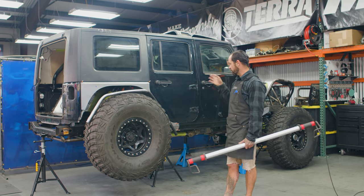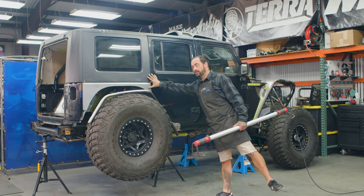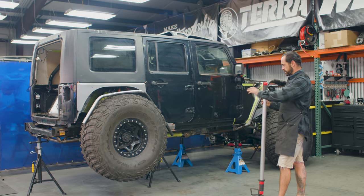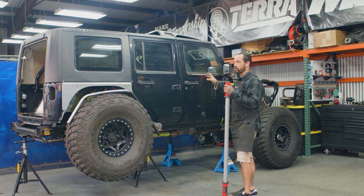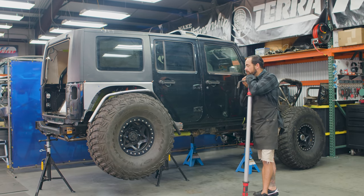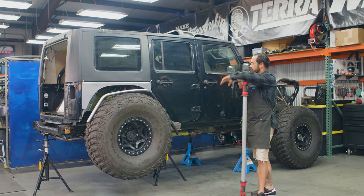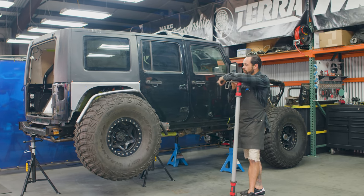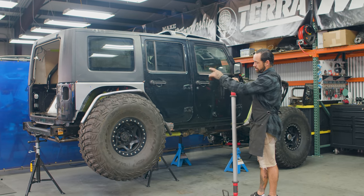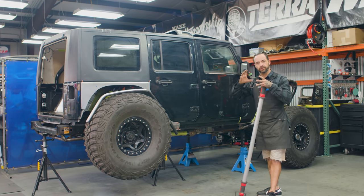What I want to get into first — I'm going to set it up talking about the sheet metal inside here. The situation with the Jeep is it's got the OEM style cage, which looks like some big three-inch pieces in there. It's not a full chassis-like cage situation. So the rear chassis, the shock towers, and the cradle going under there for the air compressor, the tank, and the battery — that's all still floating on the frame. This thing is going to have flex.